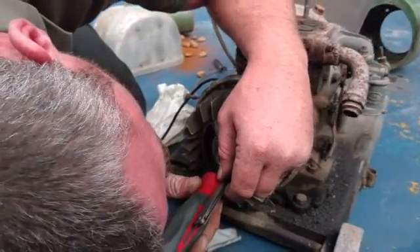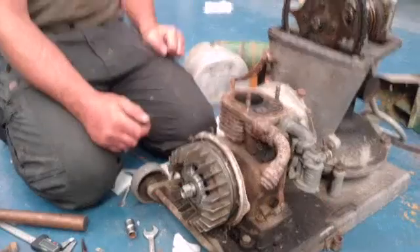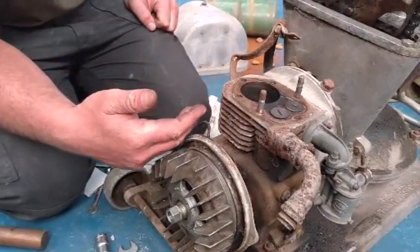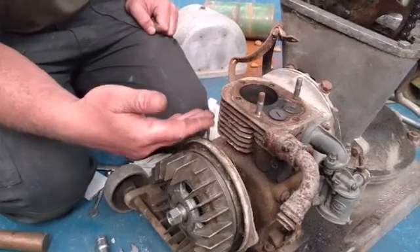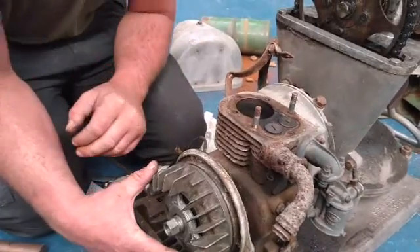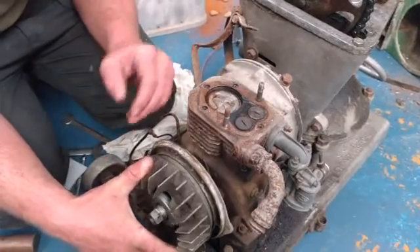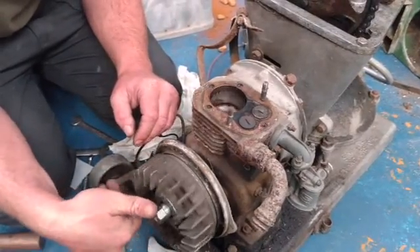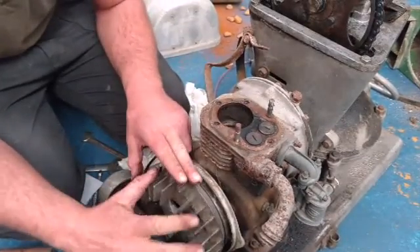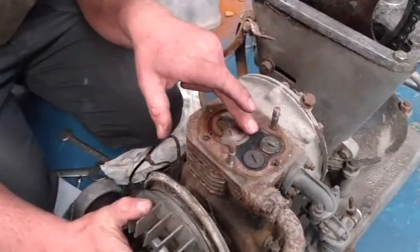This gap is critical. Now we need to get the piston on the right stroke and the right advance, so that's why we're taking the cylinder head off. We've got to turn the engine around. This is compression stroke - none of the valves are open. We'll just check that. Exhaust. This is the correct rotation of the engine. Inlet. Compression. And TDC - top dead centre - on the compression stroke.